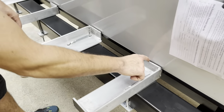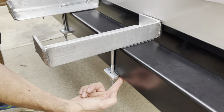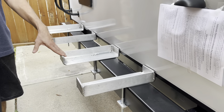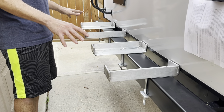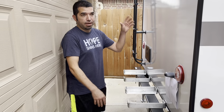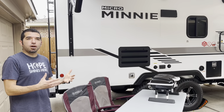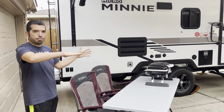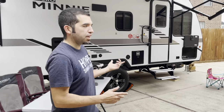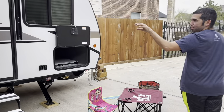I slipped in a little bit of foam so that it doesn't hit the trailer, and I put some rubber isolation mounts to not scratch up the trailer. In the future, I'll probably powder coat or hard anodize these to make them look a little nicer and match the overall look of the trailer. The other reason I did this was that by upgrading the tanks up front, I ended up with a lot of weight that exceeded what the car was able to do. So by putting a little bit of weight in the rear, this helped balance the weight. I'm still keeping the 11 to 15% recommended total weight on the tongue, but I was able to remove almost 100 pounds by putting the generators and the propane tanks in the back.